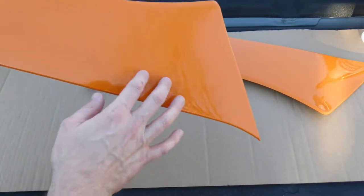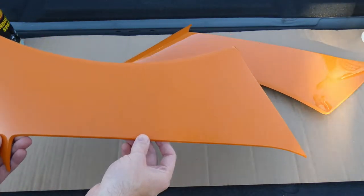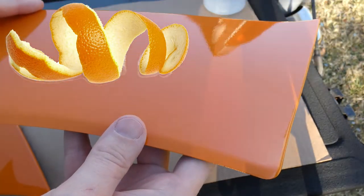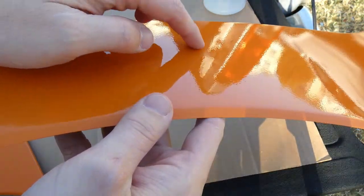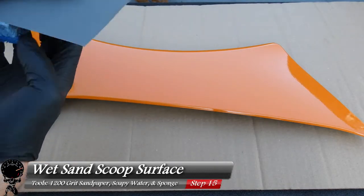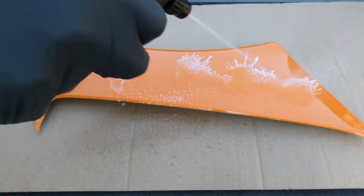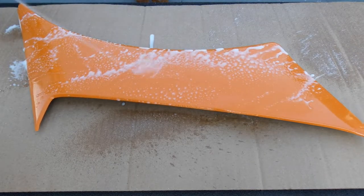Taking a good look, they feel pretty good, but in certain lighting you can see a little bit of bumps — it looks like an orange peel. That's what we have — a little bit of orange peel. This is kind of expected based on the way I was clear coating, because there were certain angles where I wasn't perpendicular to the part. But no worries — grab your 1200-grit sandpaper and sponge and we're going to wet sand the scoop to get rid of that orange peel. By using very fine sandpaper and soapy water, we can sand down the surface to get a glass finish.